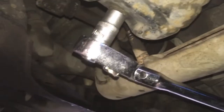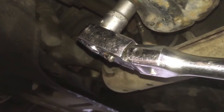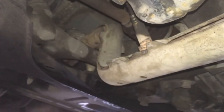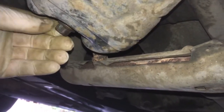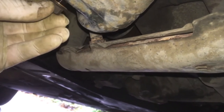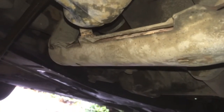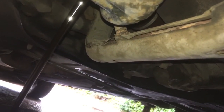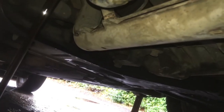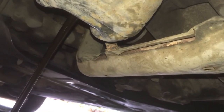So this is where you drain out the oil. Just want to break loose the bolt on the sump first. That is now loose. Just want to take out this bolt — this is the sump plug. Just let the oil drain out and keep draining until it turns into just a little drip.